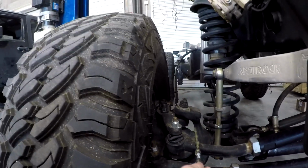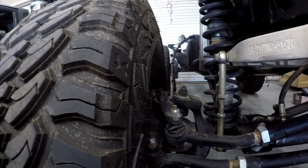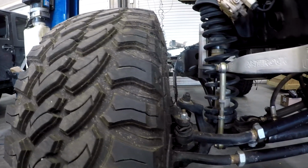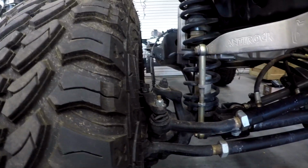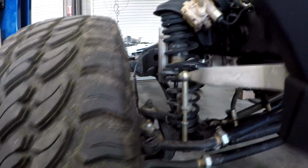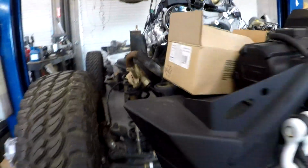And these C's need to be strong with a V8. You get a lot more torque than you had with a little V6. So if you upgrade your axle, make sure that these C's are beefed up, or if you have stock axles, you can actually have them beefed up. And again, I think you can see how loose these tie rods are, or these sway bar links are, and that allows this thing, especially with a 3-link, to get roly-poly.